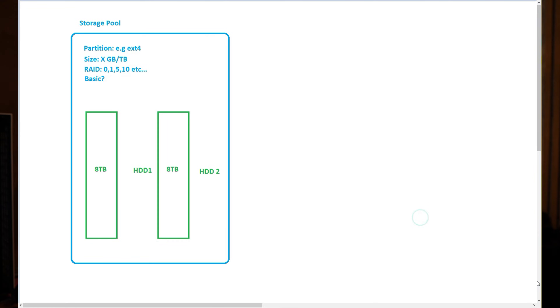If you migrate from a very old Synology unit, migration can be pretty hard. The way Synology utilizes the drive hasn't really changed, but the migration tools have changed a lot. A storage pool in Synology basically holds information about the hard drives you want to put into a RAID or use in any configuration — it's a wrapper around your drives. Also, the DSM software runs off the storage you put into the Synology unit, taking up a little space on your drives.